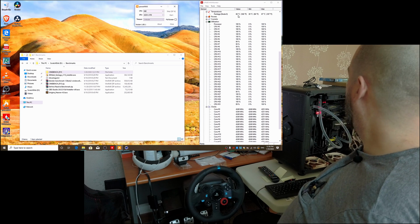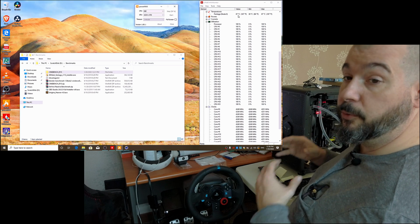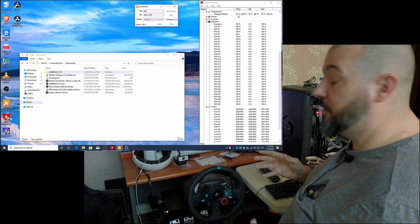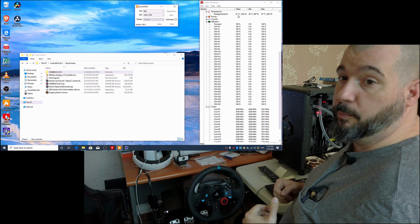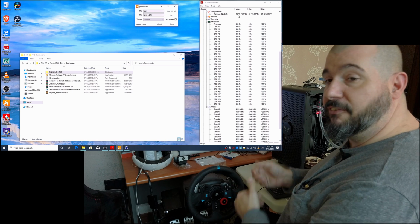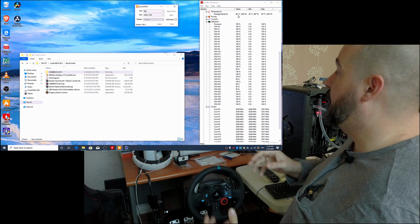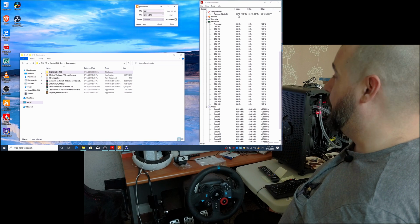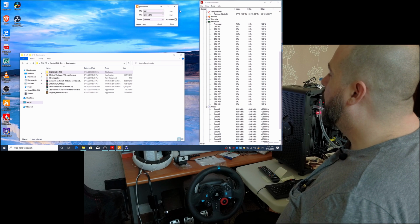What worries me is the liquid cooling system I got. Even though I've got two 240 coolers running water through to dissipate heat, because the fluid gaming system is designed as an all aluminum system, the heatsink that has to get the heat off of the CPU and into the water is also aluminum. Aluminum gets rid of heat faster, but it does not absorb heat as fast as copper, which is why you normally find air coolers that have copper blocks and then aluminum fins. Unfortunately, you can do that when they're dry. When they're wet, you cannot mix metals. You cause corrosion, and you don't want corrosion in your liquid cooling system. So 88 C, that wasn't worrying me that much.